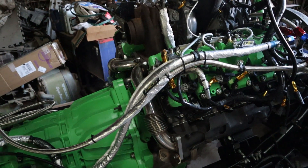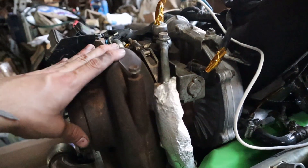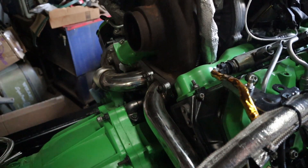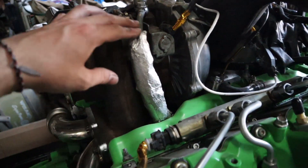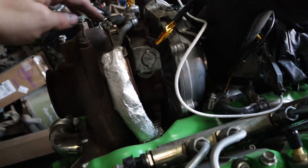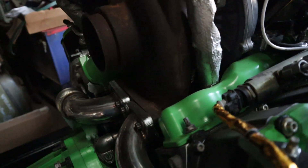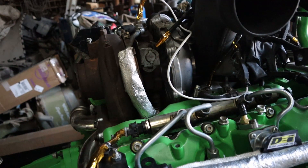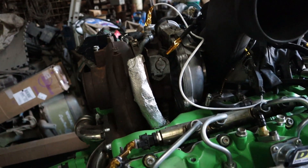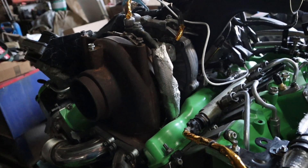While we're waiting for those few little parts for the fuel system to be complete, I'm going to remove the turbo. I have a new turbo going on this and we're going to change the way the lines are run. This little feed line is actually going to run to a different location on the engine — it should be cooler temperatures. Right now it comes from the valley, which is already used oil through this engine. Moving that location should give cleaner and cooler oil going into the turbo, help it run better, last longer, and just keep it cleaner overall.